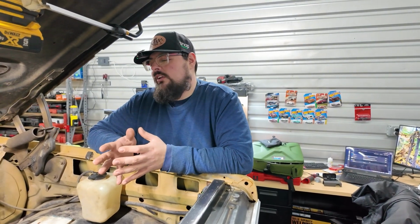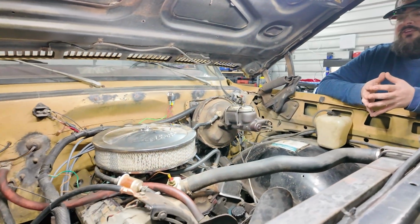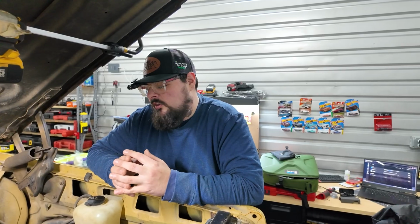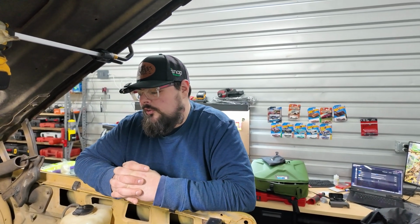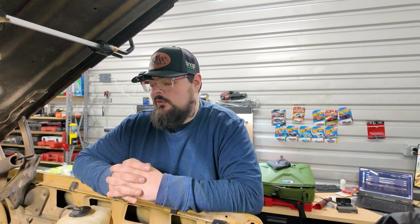And then we found out it needed a transmission because they decided to swap out the 4-speed that was in it. But the block's broken. It's a common problem with older 350s that the starter bolt holes are no longer a part of the block, and we just lucked out in both holes. So Nick is building a 454. I figured I'll just steal his old engine, and now I'm forced to be big block swapped.